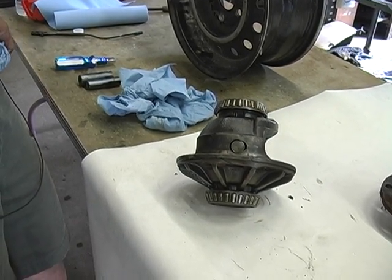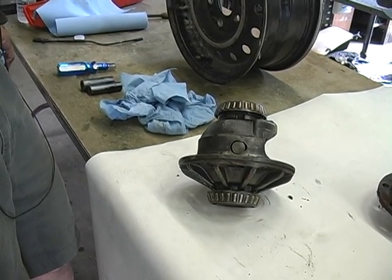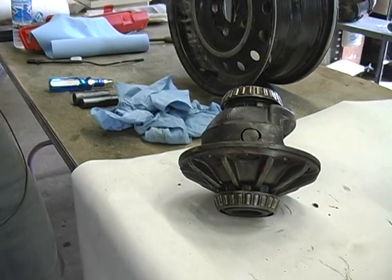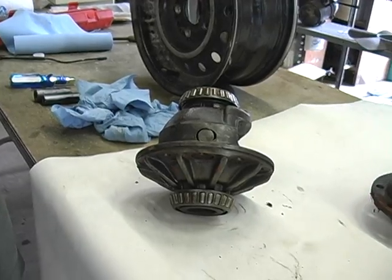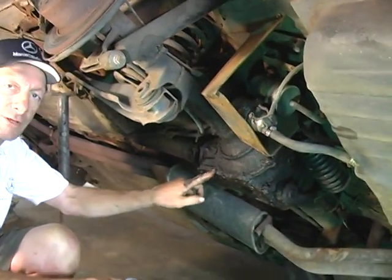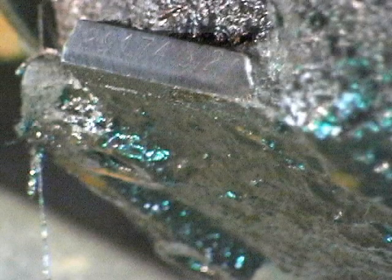These can be repaired, but that's something you have to consider. The quick fix is to V it out and find someone good at welding castings and just weld it in solid. The correct way may be to take it all apart and machine it out and weld it up, but that would be an expensive fix. This is where you're going to find the gear ratio on this rear axle — it's stamped in this little flange right here. Before you go to all the trouble of taking this out, you'll want to check the ratio to make sure it's the one you want, because somewhere along the line someone may have changed the rear axle.